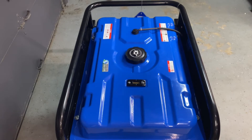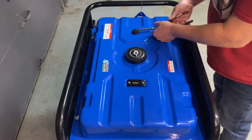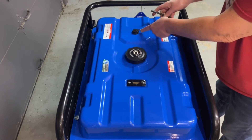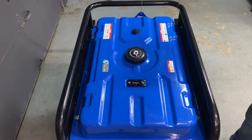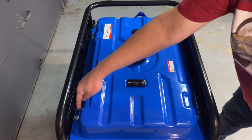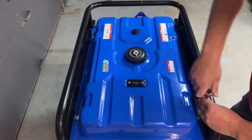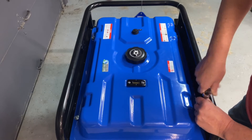Now we've got to remove the gas tank — it's a really simple setup. We'll just go ahead and pull the clamp off here, pull your hose off. Be careful you don't crack that, it's just plastic. Then we're going to remove the four outer bolts — these are 8-millimeter. Pretty much everything is 8 and 10 on these.